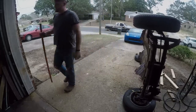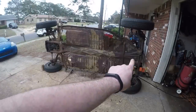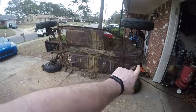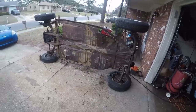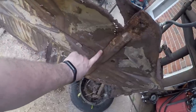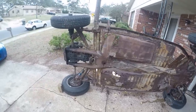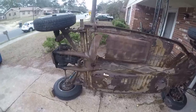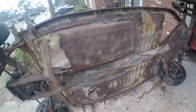And that's how you flip up a floor pan. Looking at the bottom of the tunnel, I'm glad to see that there's no rust through the center of it, all the way back to the frame horns, and that underneath the frame head area up front, there's no rust there either — nothing that's not superficial, anyway. Now that I've got this up in the air, you'll see very easily where I need to cut. I've got to cut right along these seams. And I've discovered that since my other videos, it's a whole lot easier to hit it from the bottom because you can see exactly where you're supposed to be cutting from and what you don't want to cut through. You don't want to cut through this tunnel part — I've done that a couple times and I've had to patch it up.